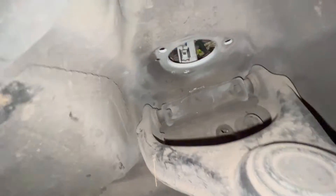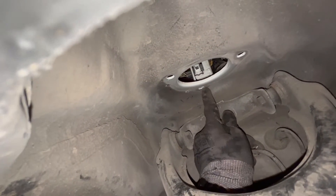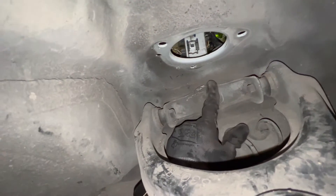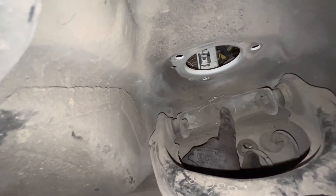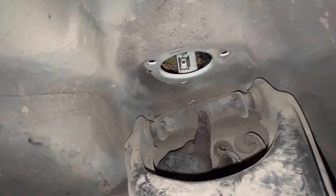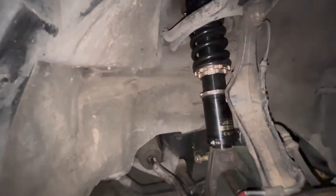This one gave us a little trouble. We were trying to take this coil out and the last bolt would not come all the way through — the top of the strut housing was hitting this little lip here. We had to get a little pry bar in there and pull it off that lip because it just would not move. We tried lifting and lowering the wheel assembly, we tried twisting it — that pry bar was the only fix.